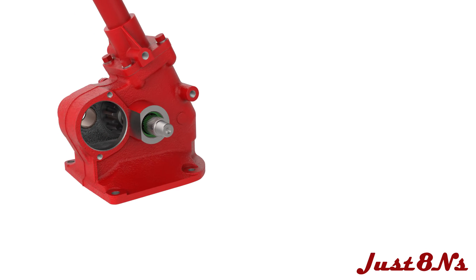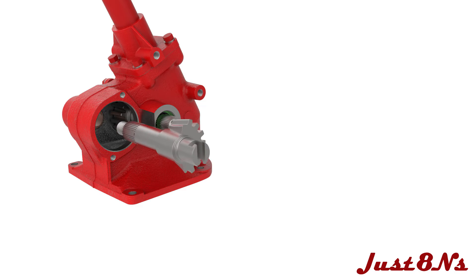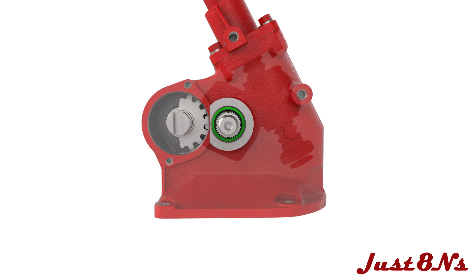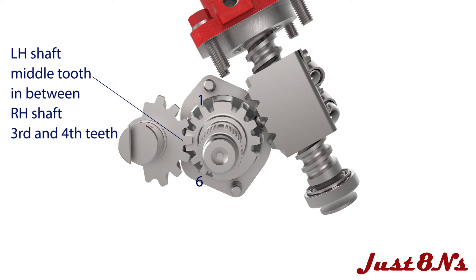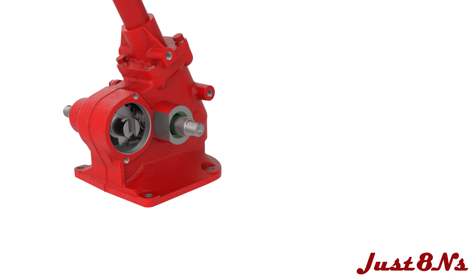This procedure is repeated for the left hand side sector shaft and cover. The alignment of the left hand sector gear teeth is accomplished by first ensuring the correct alignment of the ball nut and right hand sector shaft and that the ball nut is centered on the steering shaft. Make sure that the middle tooth of the seven gear teeth on the left hand sector shaft is engaged with the center groove of the right hand sector gear teeth. Repeat the procedure for installing the sector shaft adjuster and sector shaft cover.